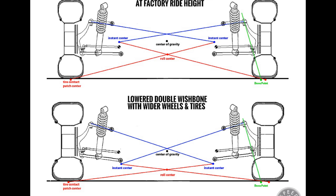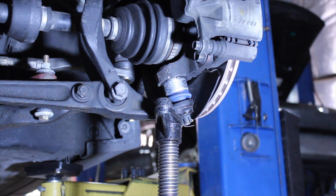The reason why I did this was driving the car on the track, I realized that the front end of the car was dead, or as if it was not reacting the way I needed it to — cutting through tires, just all kinds of funky stuff. After looking around at the geometry changes out there, I found mini ball joints like Buddy Clubs that were a starting point.